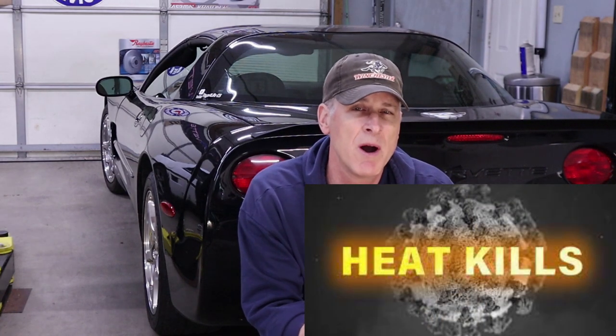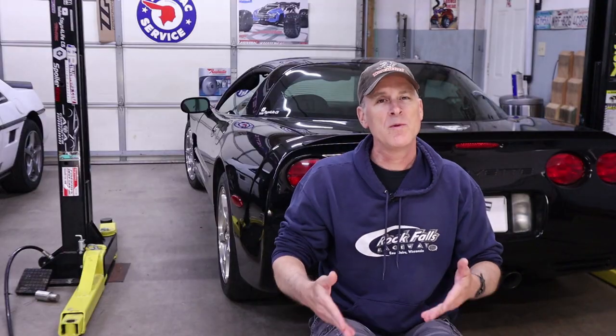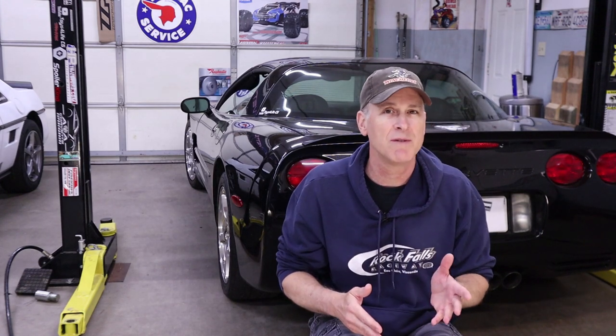There's also a secondary benefit to keeping coolant temperatures down in the low to mid 200s: lower under-hood heat means a less harsh environment for your fuel injectors, wiring harness, alternator, AC compressor, oil pressure sending unit, and more. If you keep your C5 for many years, I think it will pay dividends. I hope you now have a lot more information about this subject — please hit that thumbs up, subscribe, leave a comment, and thanks for watching.